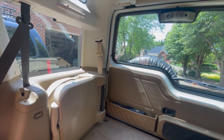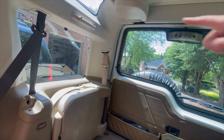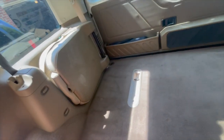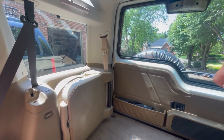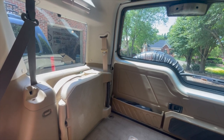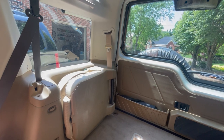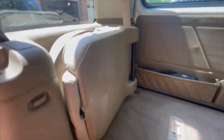The other tools you need, other than a normal set of sockets and wrenches and various Torx drivers, you need a tap and die set, because some of the bolt holes that hold the seatbelt have not been tapped. You also have to cut your carpet. So it's a lot of work for that little jump seat, but it can be done if you can find all the donor pieces. I think that's the only way it'd be at all worth it, if you can find one at a pick-apart yard or a junkyard and get it for cheap. I think I did it for about $200.